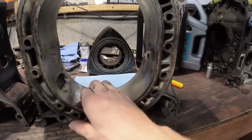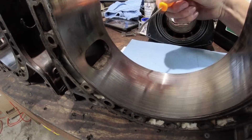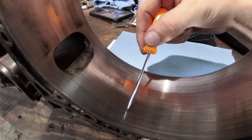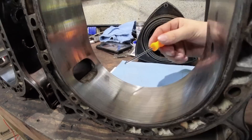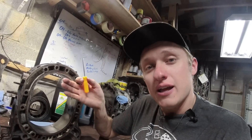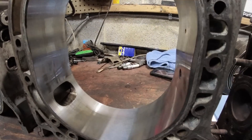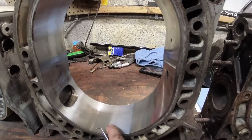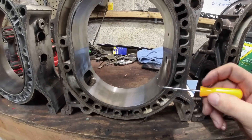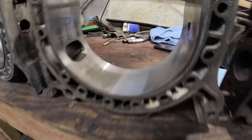This is the housing that came out of that half bridge engine. You can see some scoring in here — you can hear the scoring. But overall, uniform. Remember, the iRotary apex seals were the ones that, yes, they were a bit rough, but they didn't have any outlandish mountains or valleys on them. This housing, the middle one, came from the same engine — I've resurfaced the bottom of it here and you can tell just how much nicer and smoother that looks.